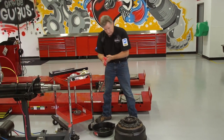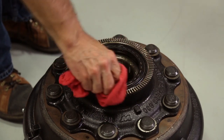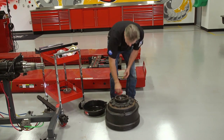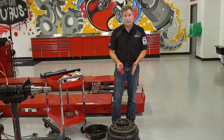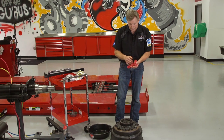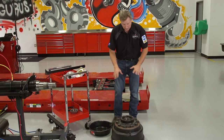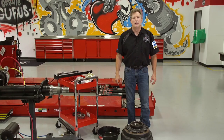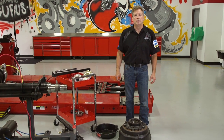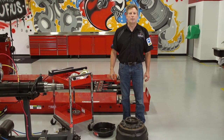One of the last things you need to do is wipe down the oil around the outside of the seal. If you leave that oil there during an inspection it's going to look like a seal failure, and the driver will get pulled out of service for a seal leak. So clean it up real well because it's obviously not an old leak. This concludes the installation of our hub seal. Thanks for watching and for more heavy-duty tech tips like this, please subscribe to our YouTube channel.